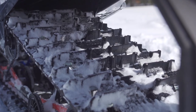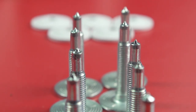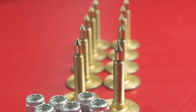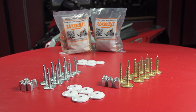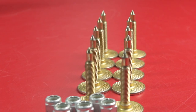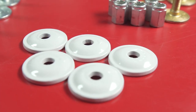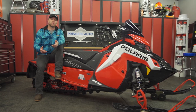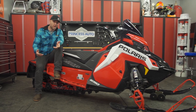If you opted for either of the Cobra track options in 1.3 or 1.6, you can still utilize studs like the Grandmaster or Grandmaster Pro. They're designed to be used in single-ply tracks, and the Pro is now available with a much more pronounced sharpened carbide tip for even better traction. You can buy Woody's stud kits with all the nuts and backers in one package, or customize the backer shape and color to match your ride. Now with the two-inch paddle out back, we're completely out of studding territory, but we're still getting huge bite, especially on days where the snow is fresh and deep, or likewise soft and heavy.